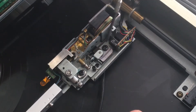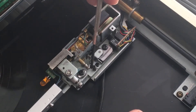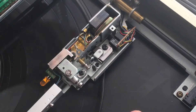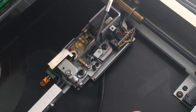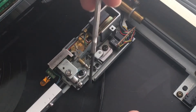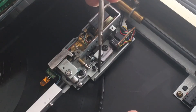The only other adjustments of note: you have this screw right here which is attached to the free-floating plate. It goes through that plate and onto the bottom chassis, and that is your tonearm height when it's at rest. So when it drops down — when this pivots up and down and drops down — it's going to rest on that screw onto the bottom chassis here. That's how you adjust that.